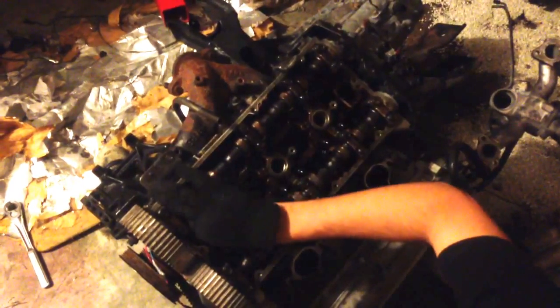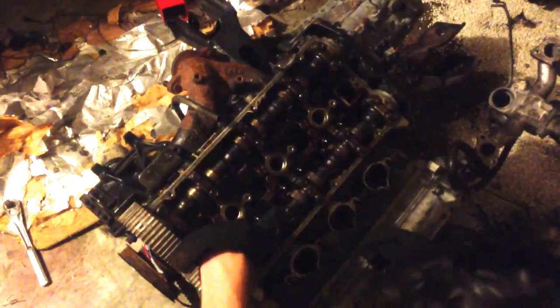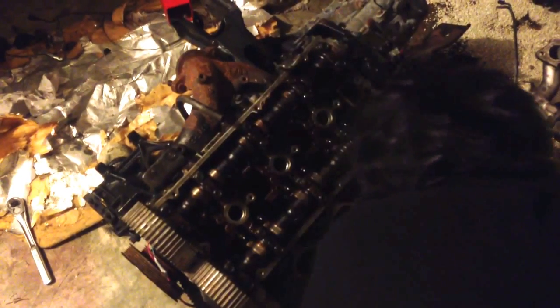I mean, look at it this way. You're not going to do any harm by putting new bolts in. It can be kind of pricey though. I'll look it up and I'll update it in the description whether or not these are stretch bolts. There's 8 of them on each head though, so hopefully they're not $10 a bolt, but they very well could be. On a Mini Cooper, it was $14 a bolt. You can generally save some money if you opt for head studs instead.